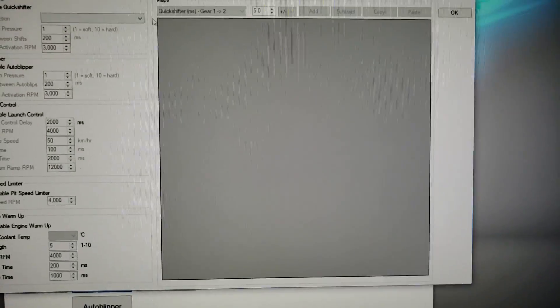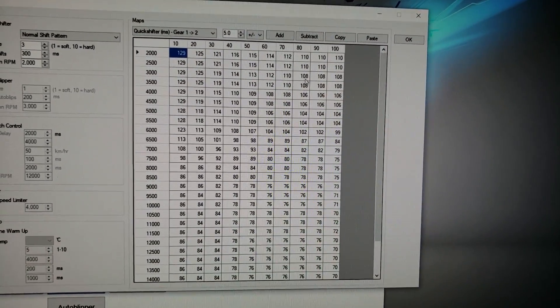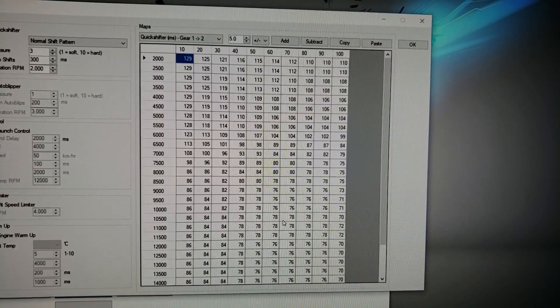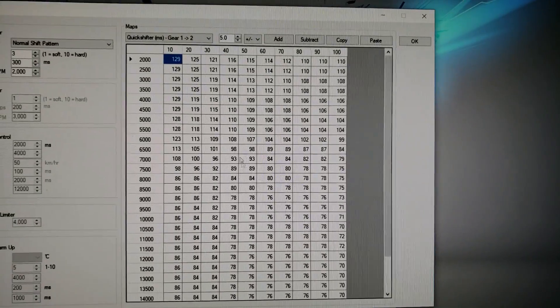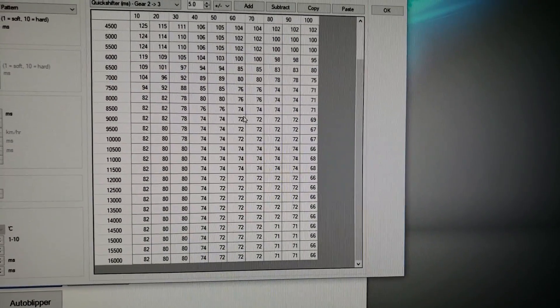What this starts doing is it'll start missing gears long before it ever shifts as fast as you can get the adjustment in race tools. So I leave this all at 100 and use race tools instead. Popping into race tools and enabling quick shifter, you now have an actual map that's in milliseconds. This is the factory map and it's pretty cringe - 70 milliseconds at wide open throttle shifts. This map is meant to be changed, no question.